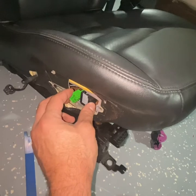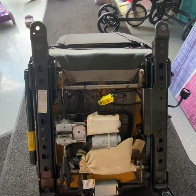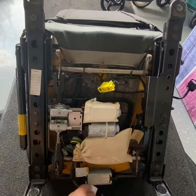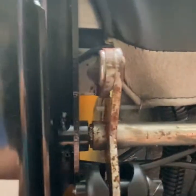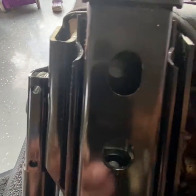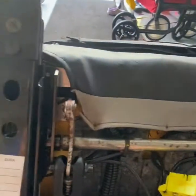At this point you are ready to disassemble the seat - we'll start step two. Got the seat flipped over - that's the bottom of the frame, the main rail, all the guts, airbag harness, your main electrical harness. First thing you want to do is remove these clips that hold down your bottom cushion. You're going to have to use some side cutters - snip, snip - and then the third snip. That is the first step.